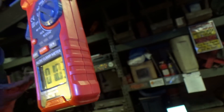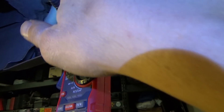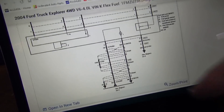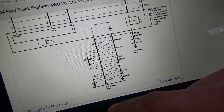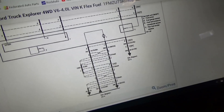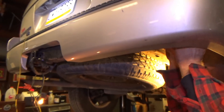The current is coming back on a skinny black wire — one amp right there. I've never seen this on any harness before, but these fuel pump wires are wrapped in a sheath that's grounded — it's like a shield. You can see it right here. That third wire is the shield wire. So the current is coming in on the pink and black through C422, shorted somewhere to the sheath, and coming back on the little wire.